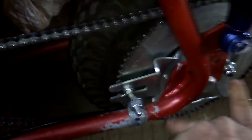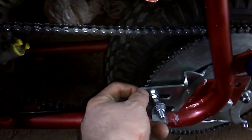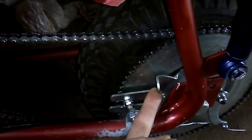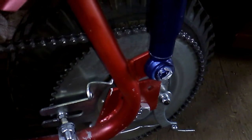So what I had done is get the back brake drum, and this I had to do a lot of thinking, creative thinking, going down to the back and how to get this particular setup, because when I had this set up in place, it made it so that this thing would just twirl around, so I had to get a clamp, or use the old clamps that were on this setup, and then put a bolt on here, which I then ground almost completely flat, pinched this, and made it so that this wouldn't move, and then hold this drum brake pretty much in place. That made it so this would pinch in one particular spot, making it so it would not budge at all, which actually turned out quite nice.